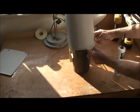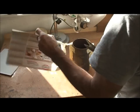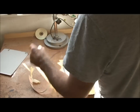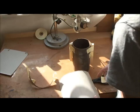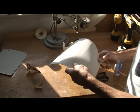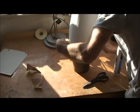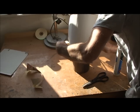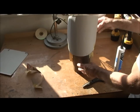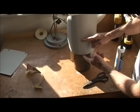Then you whip that off again and just cut that out. Get that tape back on there. Now you drop that front edge about half an inch below the top of that cowl lip — you're going to be around there somewhere, approximately there, at an angle of about 50 degrees.